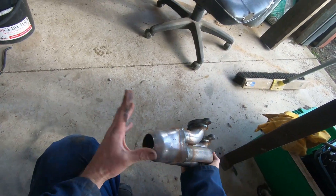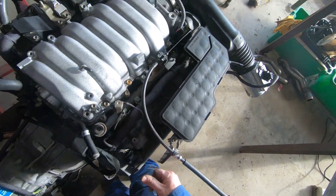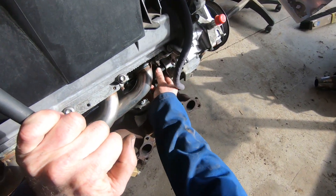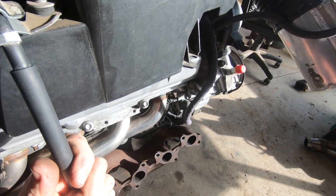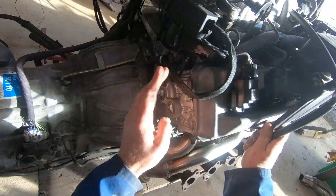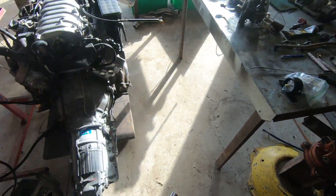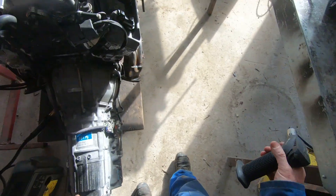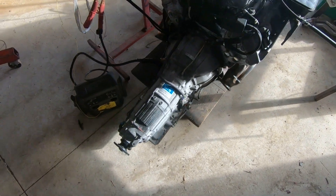I also do the same header without a flange, so if you're tight for room around that flange you can put quite a small flange on. In the wiring loom you can see it's wrapped in a cloth sleeve — cloth wrap. I actually put the alternator wiring into the main loom like a later model crown. I've only got the main power wire for the alternator coming up through here, wrapped in some heatproof covering. It's not going to catch on fire.